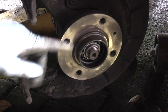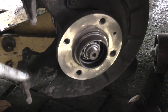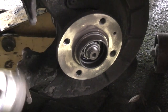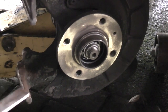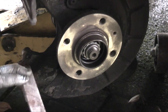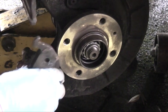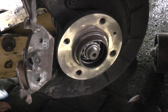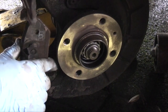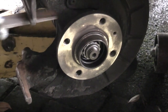I've just taken the rust off the face — I'm not bothered about the damage here, just this face because that's where the disc will mount. Now I'll tidy up these areas here. I'm just taking off the surface rust because this is where the pads locate — they run on the top of this rail, and the front, and the underneath, and the top rail. Just make sure there are no lumps or rust on there.